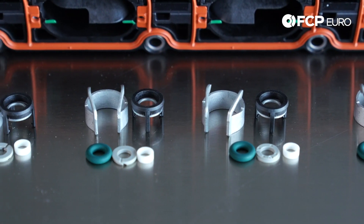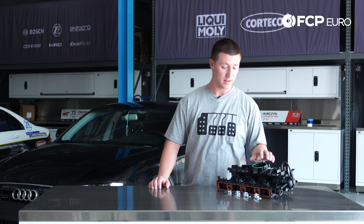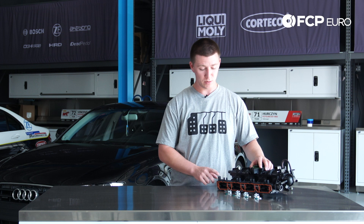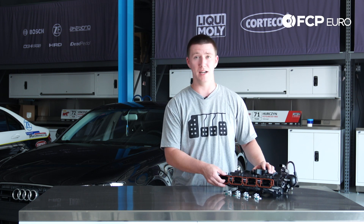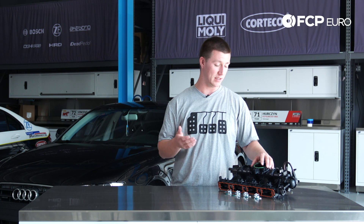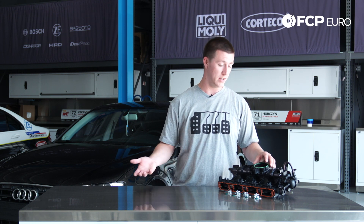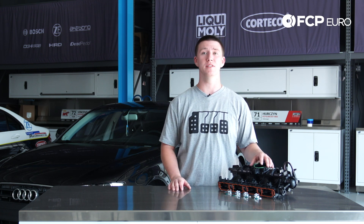When these fail you're going to see a check engine light on your dash. The fault code you're going to get is P2015, and it's because usually the solenoid goes and the actual flaps are not operating the way they're supposed to. With that being said, you're going to see a lot of rough idling or misfires across all four cylinders, and that's how you know it's time to replace your intake manifold.